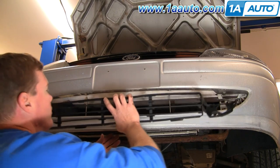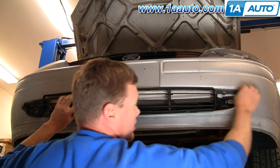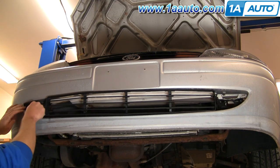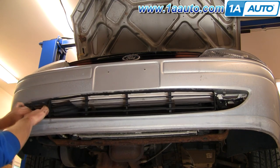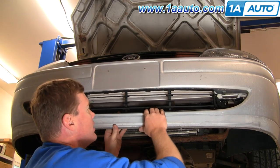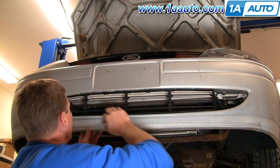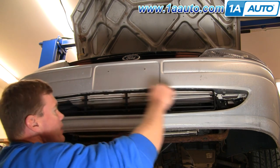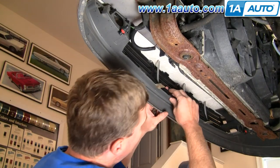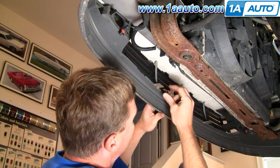Reinstalling: what should happen is if your cover is in good shape, put it up in, then guide the pins right back into the holes. Put each side in, clip it in, and then this should all just kind of clip in. But since my bumper cover is in a little bit of rough shape, I'm going to put it in, push it up, and then pull my grille back and try to get it in place. From the back side, I'll do my best to kind of get the grille underneath here.